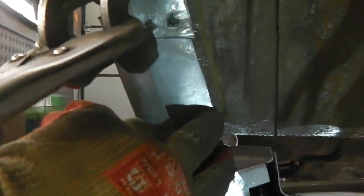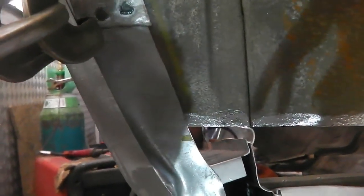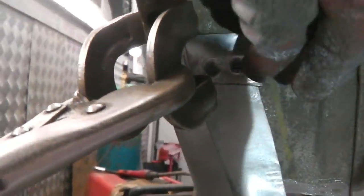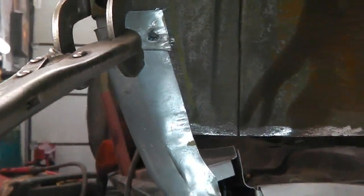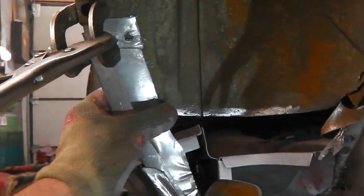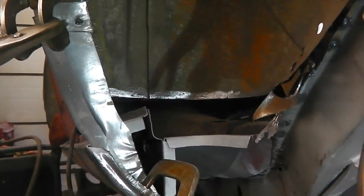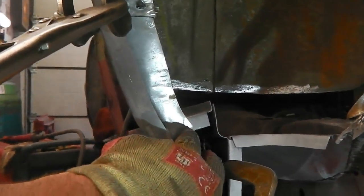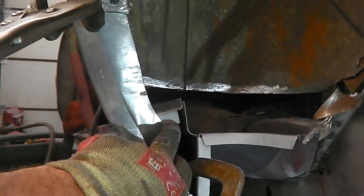And then we just need to cut out the rest of the metal now by getting a good accurate mark on here, and that's going to go in a flush fit that side with a little bit of a bump around where this joint is, but we should lose that with a skim. Should be on the whole pretty faultless and seamless repair to do. We've got a plug weld in onto these end tabs.